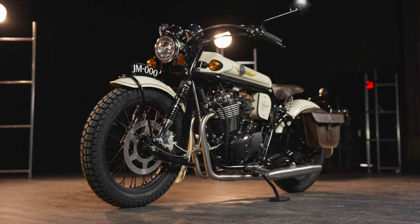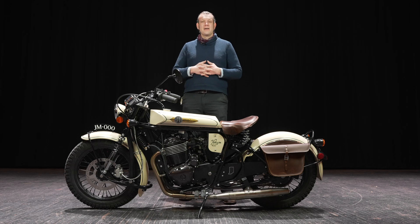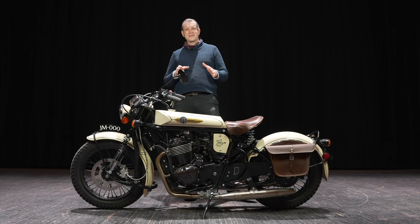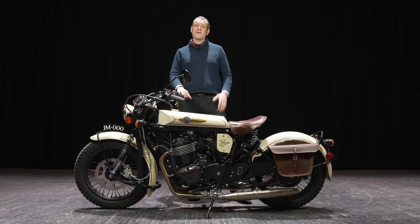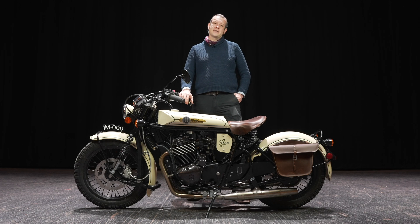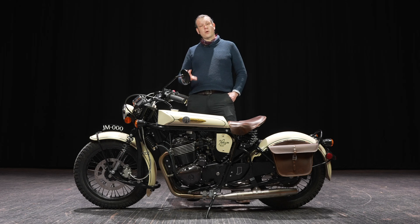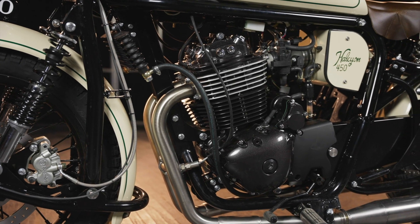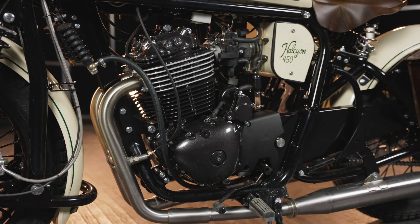The first thing you'll notice is, well, it's a 450. The engine is a single cylinder and it does have two headers. We've seen some comments online like, is it a twin? No, it's not a twin. We're really in love with the Thumper, the single cylinder and other simple engines, and this is a great next step for us. It's a four-valve single, so that means it has two intake, two exhausts, and two headers. We decided to run those as two separate exhausts rather than two into one.